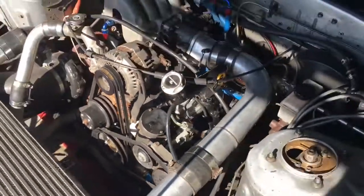And you know what? Let's fire it up and see if we got power steering. I really want to try power steering on this event. To bleed these, I'm probably going to need the car jacked up and turn the wheel left to right a million times. Damn, I don't want to do it, but I have to do it because that reservoir was dry.